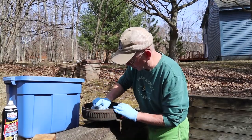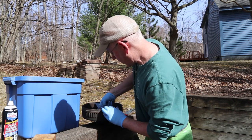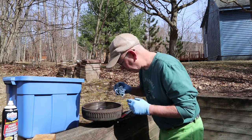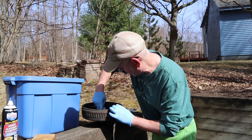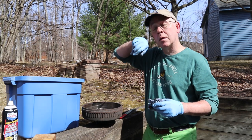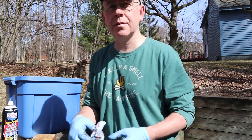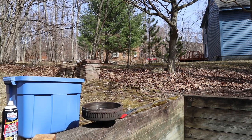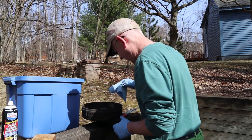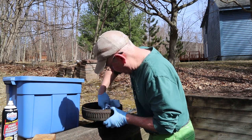Now we're going to clean the inner race of any grease. Because you want to put fresh stuff in there, right? Yep. It's really good. I'm really happy to see all that grease still in there. So repacking wheel bearings just means that you're cleaning everything up and giving it new grease. Exactly. That's all it really is. I always thought it was something where you put fresh ball bearings in there. Well, if they're damaged, you would.